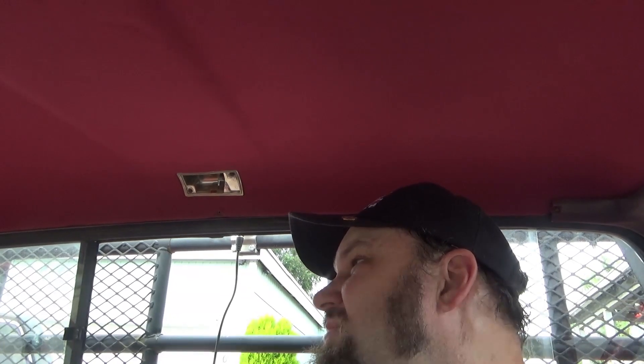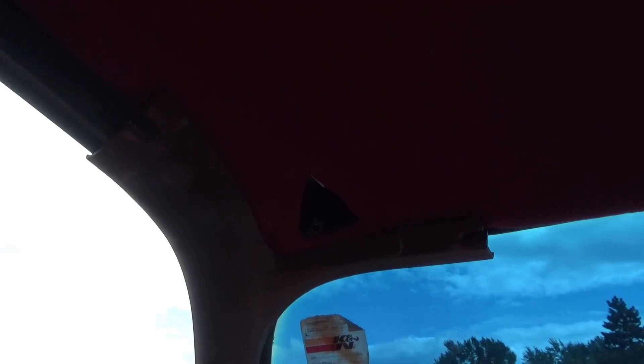We got it figured out. Looking good — no gaps all the way around. What I wound up doing is I put all the corner pieces in, and those let it float a little bit more. The sun visors — and that's actually how the instructions said to put this thing, at least on the other headliner I've got for the other truck. You use the sun visors to hold it in place, then the light, then put your trim in. They were holding it too tight before; they weren't letting it twist. The corner trim pieces go underneath all the other trim pieces, so everything else goes on top of these, and that'll help suck it all up in there.